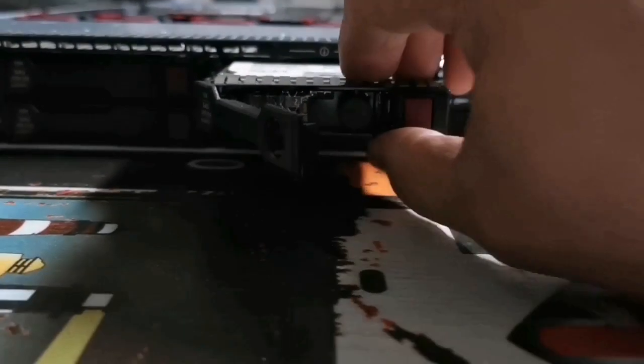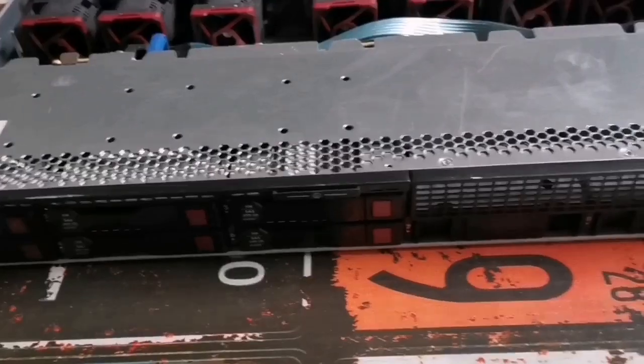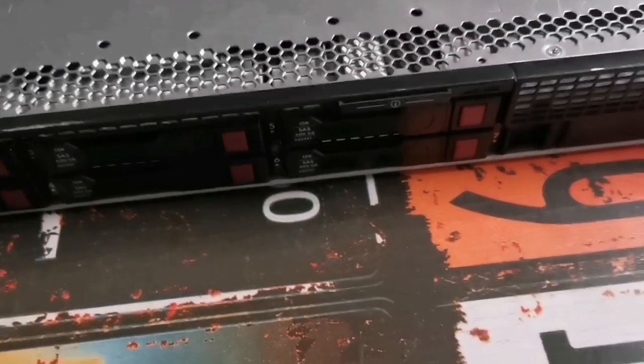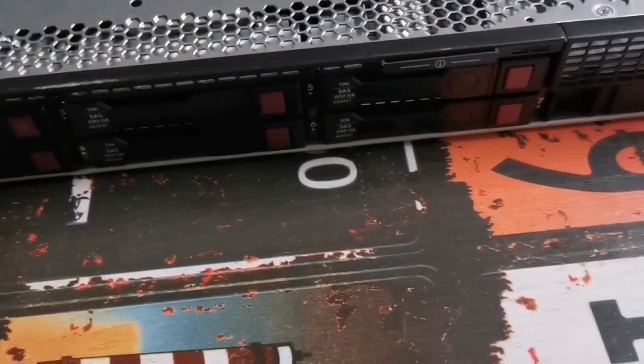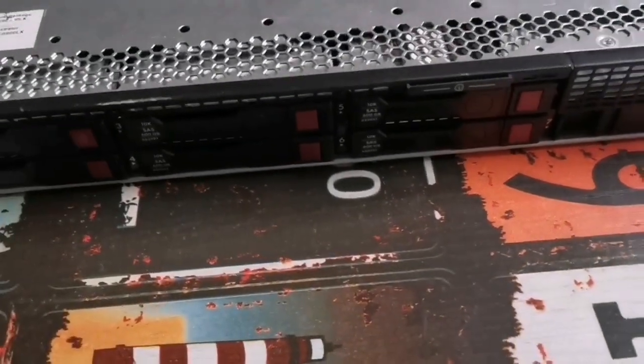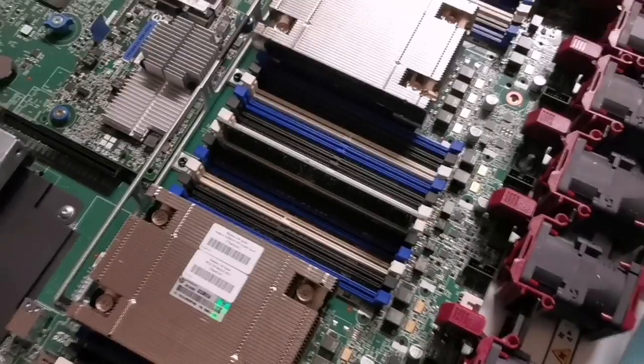The main purpose of having hard disks that slide in and out like drawers is that in case of a hard disk failure, you can replace it without turning the server off. You simply unplug it, replace the hard disk in the tray, put it back in, and it will turn on and start processing data. Also, depending on the model, hard disks may be 2.5 or 3.5 inch — this server takes 2.5 inch hard disks, while some other models take 3.5 inch.